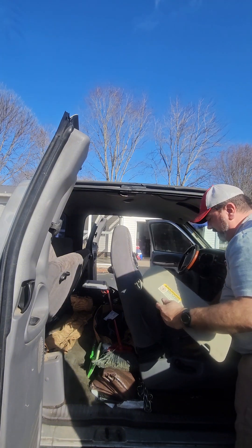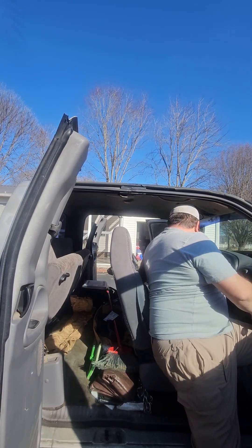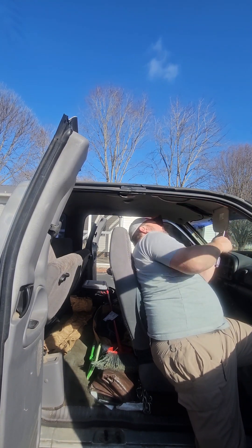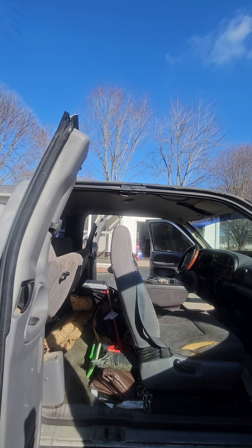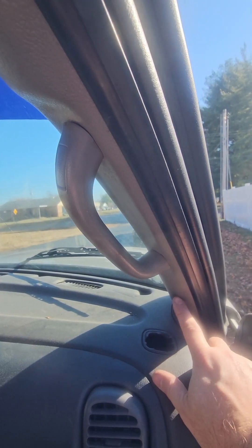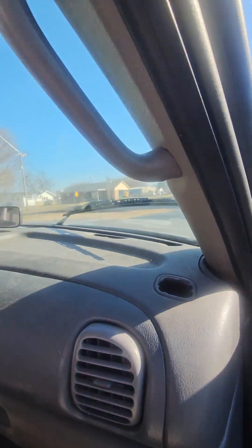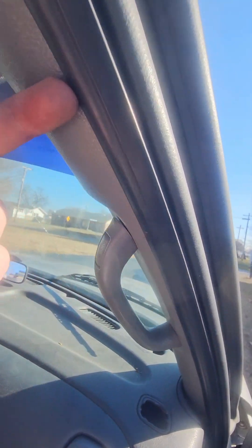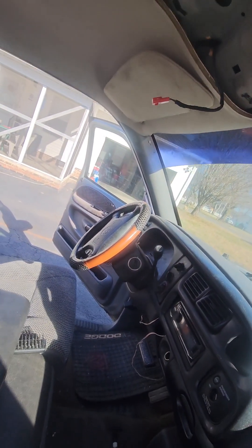Since I'm here, we're going to go ahead and put on this sun visor. Important note: your sun visors actually help hold the front end of your headliner up. On the other side, where I was trying to put the panel back — there are three clips that hold it into the frame and the weather stripping didn't want to work. What I ended up doing was taking a screwdriver, getting just behind it, running it up along the lip until I got it all the way up. A whole lot easier than trying to force it and risk breaking 25-year-old plastic.